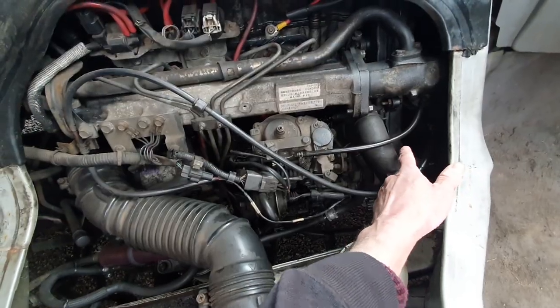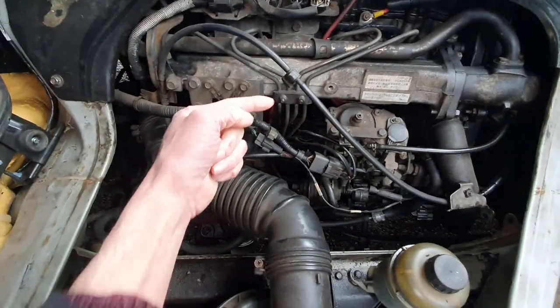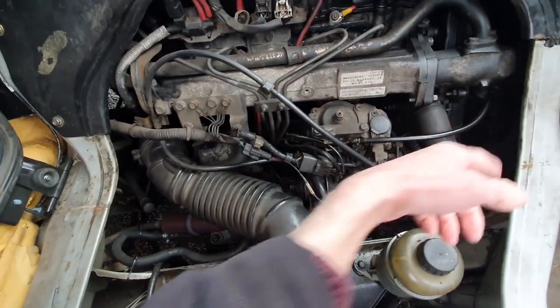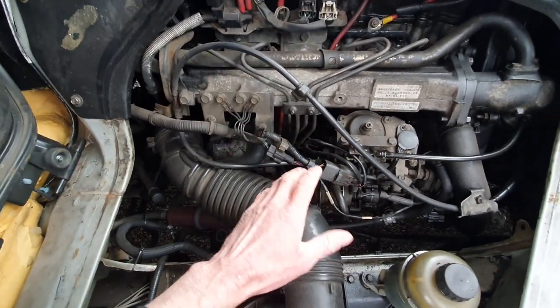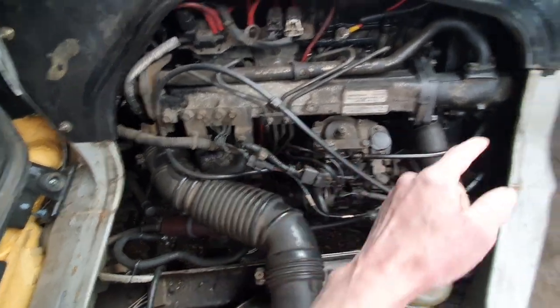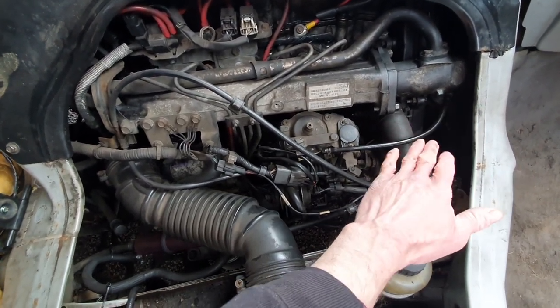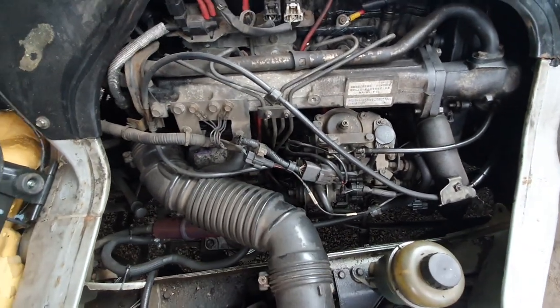To do that, I need to move the crankshaft until it's got its timing marks in the right place, and then fit our dial gauge, adjust the engine until the dial gauge reads the lowest point possible — that'll be our zero mark, I'll set that to zero. We put it back onto the position on the crankshaft, and then pivot this back and forth until it reads 1mm, or 39 thou.